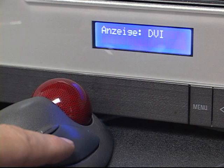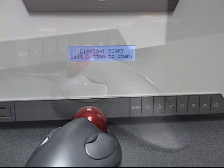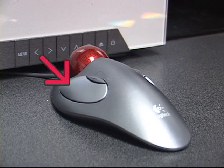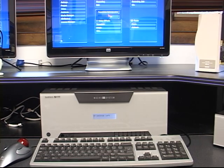It would be followed by the current display mode it's in. If the system tells you it's currently in the single analog mode, it might say display SCART. Then you can press the large left-click trackball button to toggle to the next display mode, or number keys off the keyboard can be used too. As the system was set to single analog, the next mode in line would be DVI. Just wait about 15 to 20 seconds between screen switches. This should now switch the system to single DVI output.